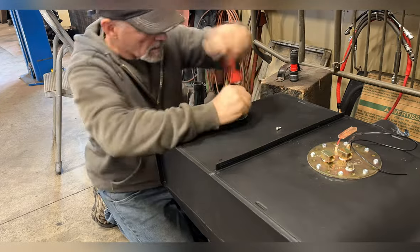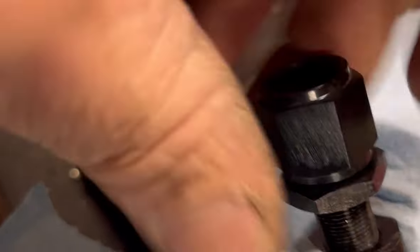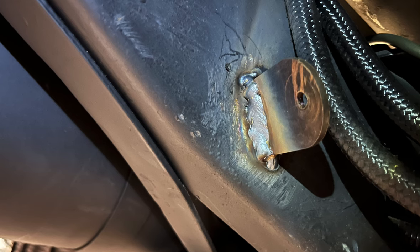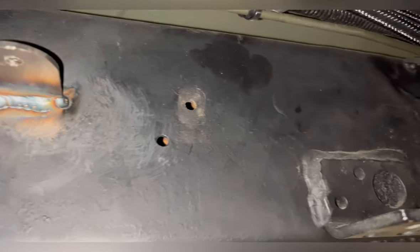Final installation, and I think we are gonna be in business with this one. Building all my fuel lines, everything is gonna be dash six AN fittings. I generally start running the lines from the engine back, and I put them around the bell housing. I kind of run them freehand, and then I add tabs where I know the lines are gonna be clamped and held in place.